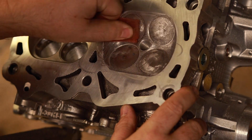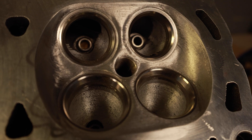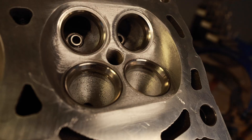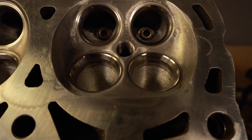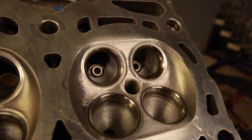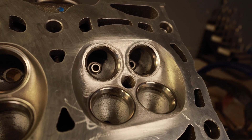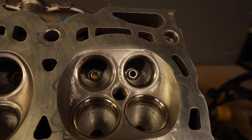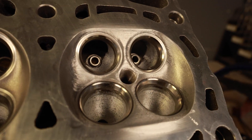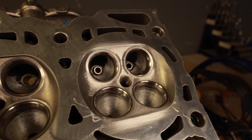Let's remember what they looked like and what they look like now. We're going to digitize this so you can see it blends right into the top cut of the valve job — that's what we want, very flush. We're not necessarily making it bigger, although we kind of are, but once you mill it — and all these heads take at least three thousandths to get them straight, new heads usually about five thousandths — that will get the combustion chamber right back to stock size. No matter what, we're looking for longevity, reliability, and power, and there is power in the combustion chamber.